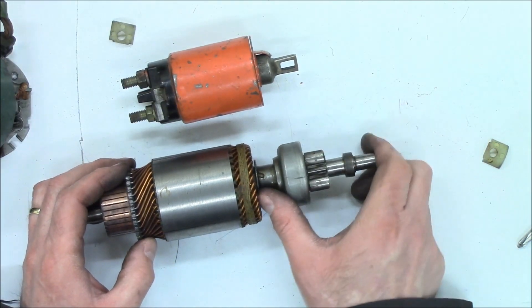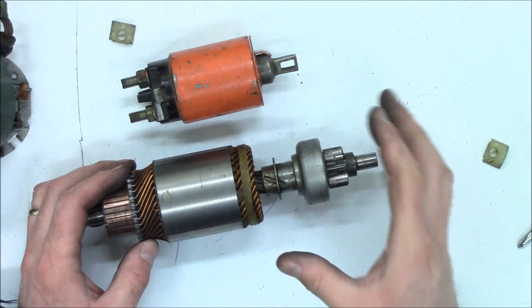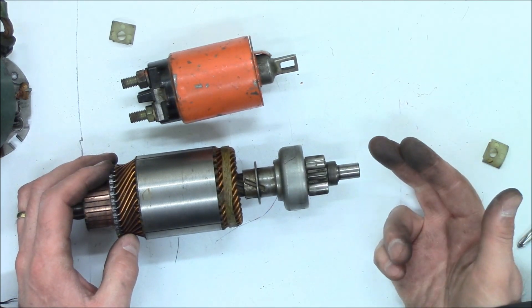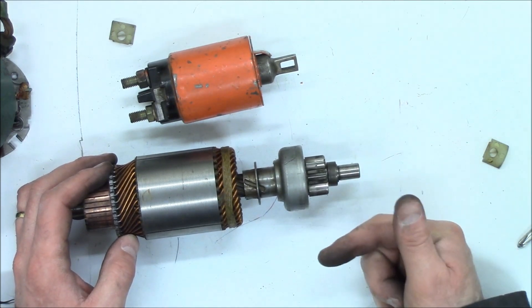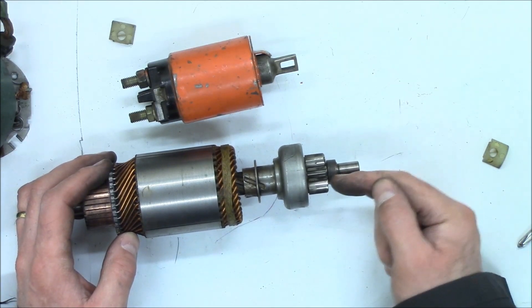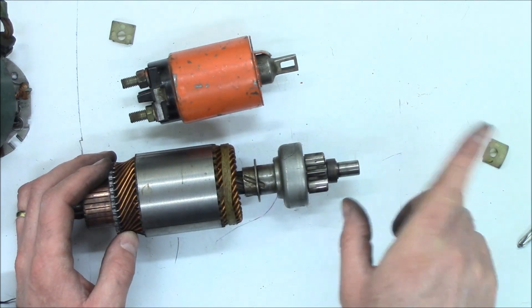No juice going to the starter — click — now we have the battery connected to the windings which feed everything else and make it rotate. As it pulls in, that lever shoves the gear into the flywheel; when the disk makes the connection, electricity goes from the battery through the windings on the housing and the armature, the magnetic fields repel each other, and this thing starts to move. Sometimes the starter might engage and stay stuck with the flywheel, and now you have a potential issue — while this cranks the engine at around 400 RPM or less, if you're now cruising at 4,000 RPM you're spinning this ten times faster than it was designed to go.